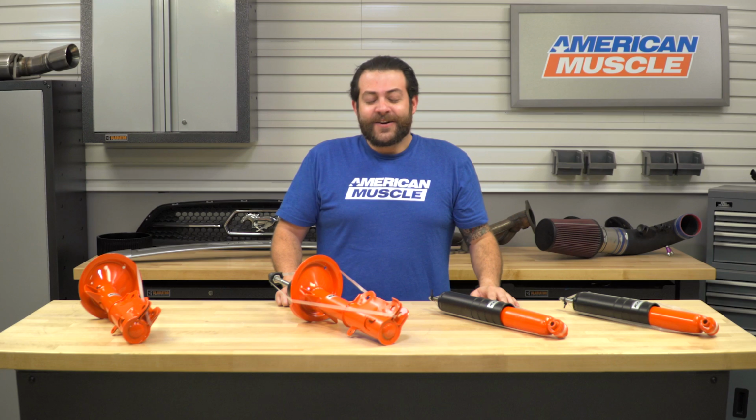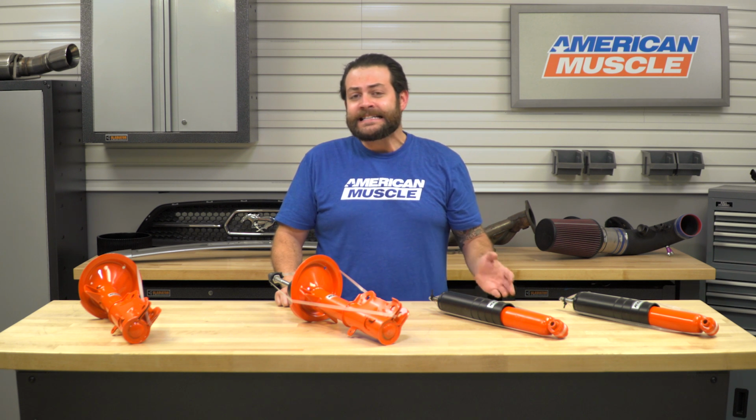Alright guys, so looking ahead, some things I'd make sure to have on site would be a basic socket set, a breaker bar, and most importantly a spring compressor when it comes time to pull your struts, and these can be rented pretty easily from a local parts store.